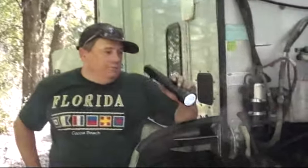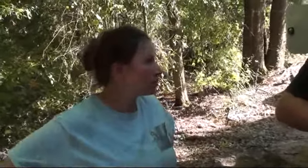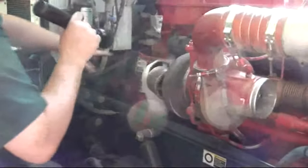You're also fortunate you're not losing coolant through the EGR cooler — it's dry, not caked up, not carbonized. It's not here either, because the after-treatment injector can actually leak coolant right into the exhaust pipe since it has coolant running through its face. If you're losing coolant somewhere, it might be your bunk core. You mentioned smelling fumes coming out of the AC ducts in the cab, so you are slowly losing it somewhere — but it's not here and you're not burning it, because that's too clean.